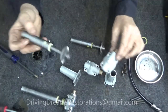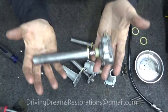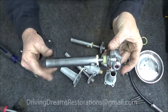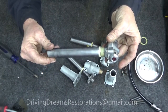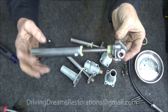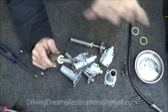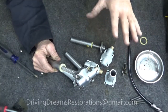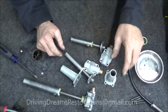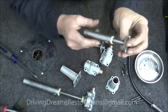The best process: when you first take this out, put it in the sandblaster — best to do that with the screw jack parts all the way in so you don't get too much sandblast material in there. But if they're all rusty, just go ahead and sandblast them, then take them apart, clean all the gunk out like I showed you, then put them in a parts washer or sonic cleaner to get all the dirt and grease out. If you have to blast them out with some brake cleaner as a last step, that's great.